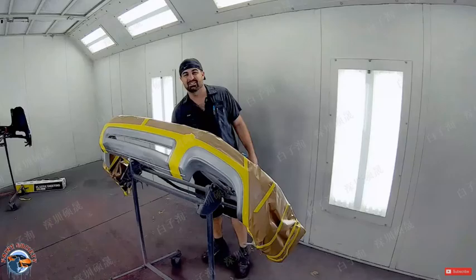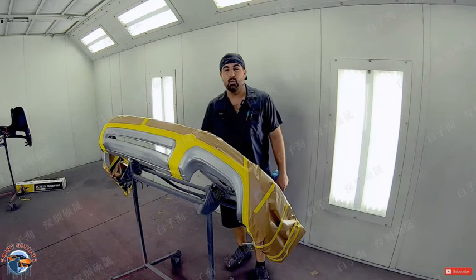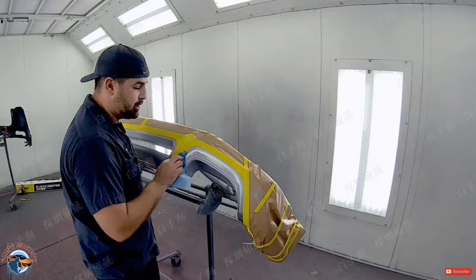Okay, so let's get caught up. We had a lip. Needed a lot of work, had damage on the black portion and the silver. We sanded it down, we primed the whole entire thing, we painted it one color. Now we're going to come back with our trim. Now the most important thing we can do right now is clean, okay? If we want that trim tape to stick, we have to clean our tape areas, and even into the area that we're going to paint, which is very important.